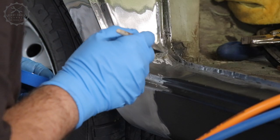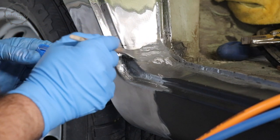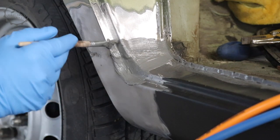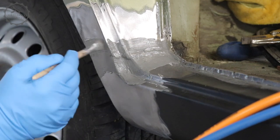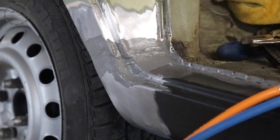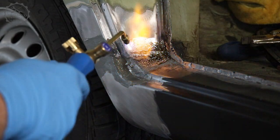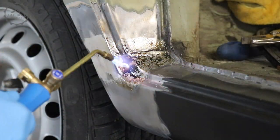Let's talk about these seams. The sheet metal used here has a thickness of 0.8mm, and it's quite clear that making an invisible butt weld requires the panels to be absolutely flush — over a length of say 2 meters from A to C pillar, with accuracy requirements of only a few tenths of a millimeter. Sounds kind of difficult. It's therefore a good idea to not grind the seams down to level zero but accept some welding bead. That raises the question of covering it — body filler would be an option and I can't see any reason not to use it, except that there is one.